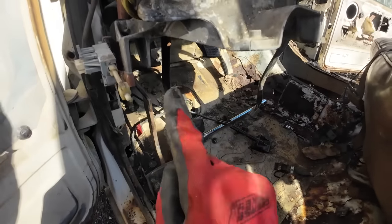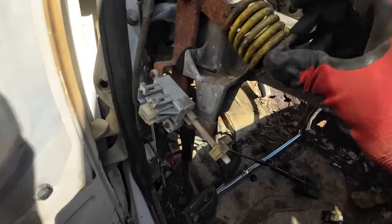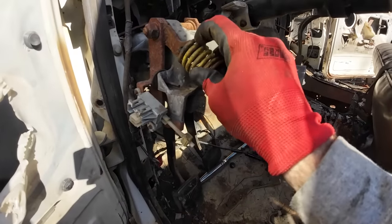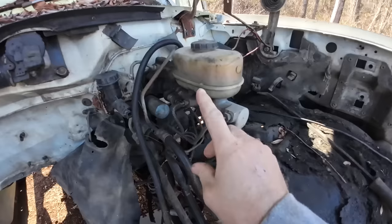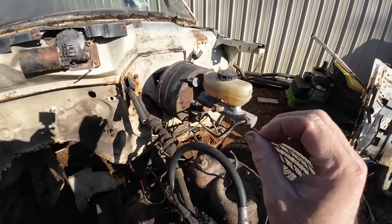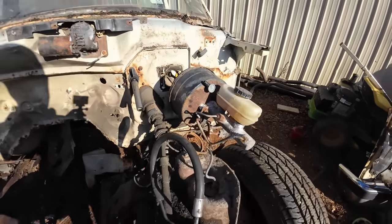So they look to be identical, but the one out of the white truck actually has this sensor here for the clutch. And this spring assembly looks to be in better shape on this one. So I'm just gonna go ahead and swap it over, and then we know for sure we're good, and we'll save that one for parts if we need it ever in the future. Another thing an awesome subscriber pointed out is this brake booster and this one operate just slightly differently from each other. So I do need to swap those out, which is convenient. Because that's what was on the backside of the pedal assembly.